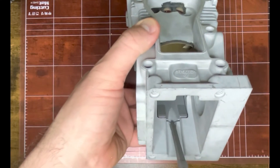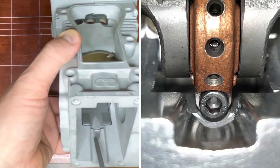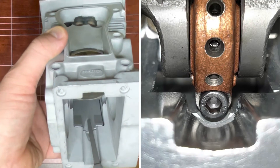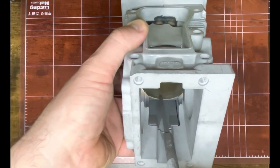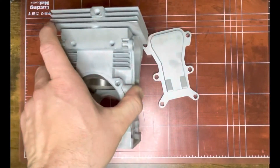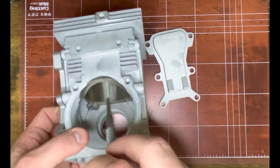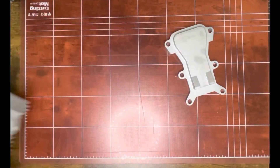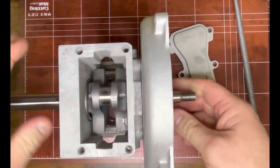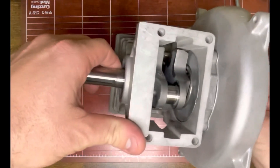When you put it all together, you've made a nice little recess right here so as that crankshaft and connecting rod comes around it's going to clear right there. Any longer stroke — like a vintage Horseman crank — you'd have to relieve this area right here and probably trim the bottom edge, the skirt of your piston, at least on this side so it's not hitting that shelf. I didn't really talk about clearancing that area in the last video, so I just wanted to point that out.